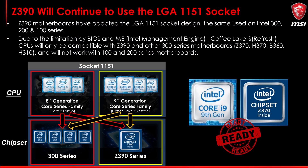Neither feature is really a game-changer, and most of you can do with what the Z370 motherboards offer. The real reason we have this new chipset is to signify that all Z390 motherboards will be up to the task of extracting maximum performance from the Core i9-9900K — that is to say, they all pack a sufficiently beefy VRM. I don't expect we'll see any Z390 motherboards with anything less than a true 6-phase VRM. If you do have a high-end Z370 board, you shouldn't have any trouble getting the most out of the new 8-core models even if you plan on overclocking. All 8th and 9th gen core processors will work on these same motherboards regardless of whether they sport a Z370, Z390, H370, B360, or even H310 chipset.